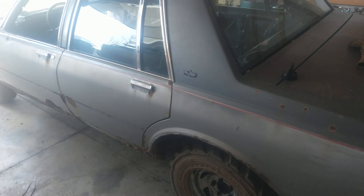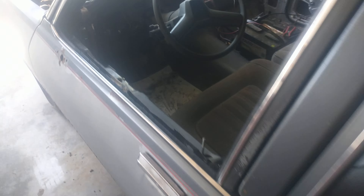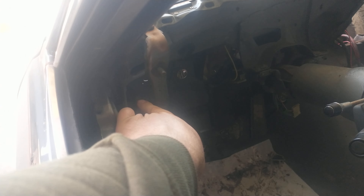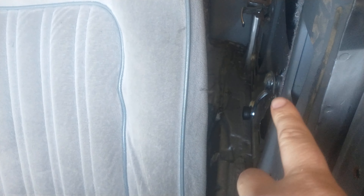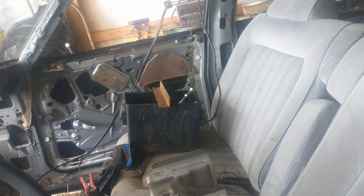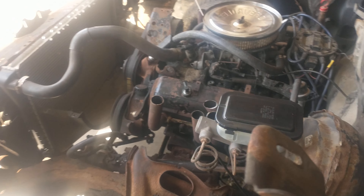Still got to put a bumper on — not sure how I'm going to do that. Got to weld the rear end yet. Like I said, I will run a dash bar, run my door bar between those two points all the way back, then do the door bars first, then put the dash bar in, then the back seat bar — and that's how she'll run.